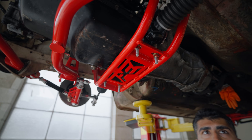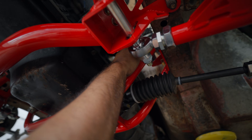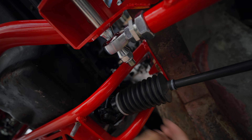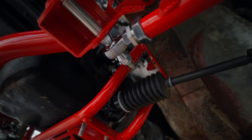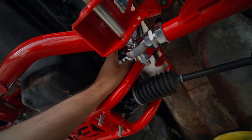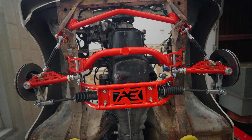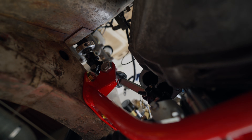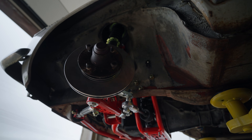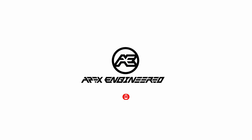That's pretty much it for the full installation. As you can see, there's ample clearance for the oil ports. This is where the exhaust outlet is — that's why a new header is recommended. You have tons of space behind here to reroute a header; it's just this factory cast iron one makes it difficult. You could possibly do a U and go all around back, but we recommend having a custom one made or some sort of modified header. We're going to go ahead and turn the steering wheel to see it in action. See you next time.